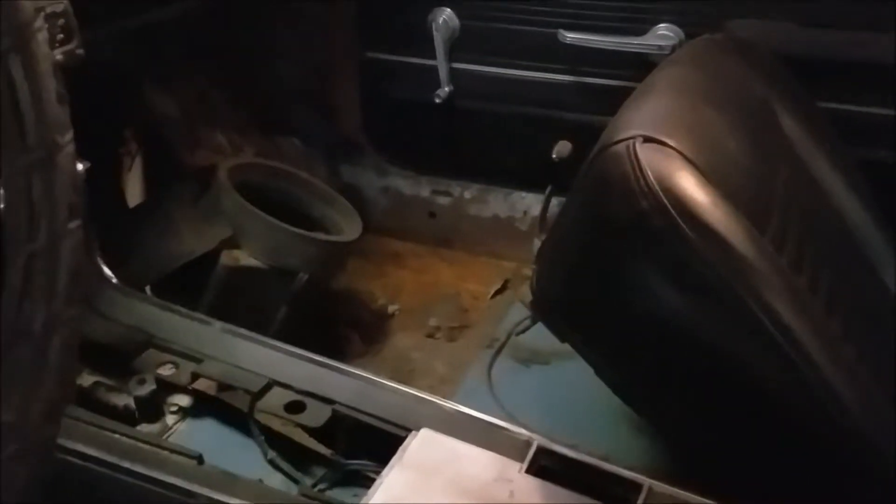At the very least I'm going to do floor pans — maybe a full floor pan, maybe a partial, it all depends on what I find when I actually grind it out. Now when I was young and dumb — you can see it over there — half of that on the ground is not surface rust, it is sand. I got a sandblaster and I'm sitting there thinking I want to get some of the rust off. If anybody has ever tried to sandblast inside of a car, you're stupid, and you don't use sand. I learned this the hard way because I was getting pelted with sand, it hurt like hell, and it was actually tearing up more things. I had cups — literally measurement cups — of sand all over, and all I did was spray for literally a minute or two.